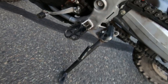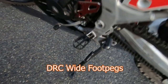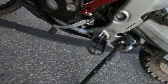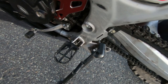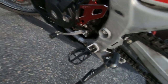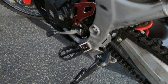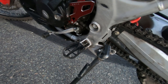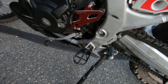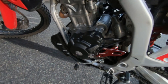I replaced the foot pegs with DRC foot pegs. They're not substantially wider and they're steel — just as heavy if not a little heavier than the stock pegs — but they are a fraction wider and they have a center row of teeth. I find having three rows of teeth really helpful, and a wider peg is slightly more comfortable. If weight's an issue you can look for aluminum pegs and pay two or three times as much.